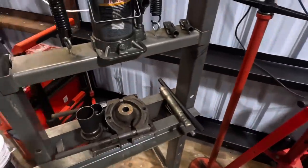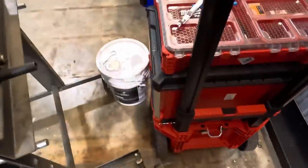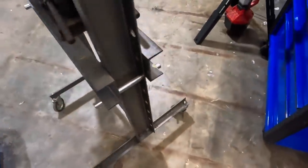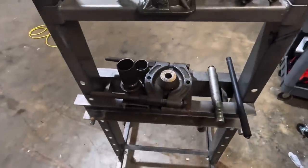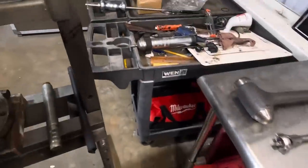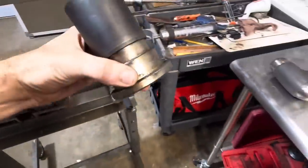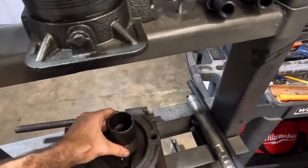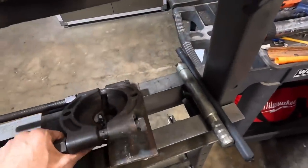So what we're going to do is roll the press out from its parking space over here. I really like that this press has wheels on it — that was an afterthought, I don't think it came with wheels. These were a Harbor Freight addition. So we're going to maneuver this guy right on over here so we can use it next to our table, and get this bearing and hub and spindle slash knuckle assembly set up in here. We'll get it pressed out, then pressed in — not in that order.